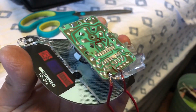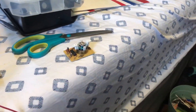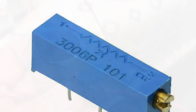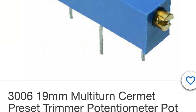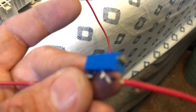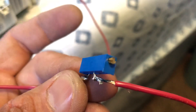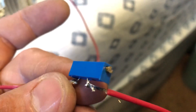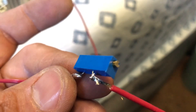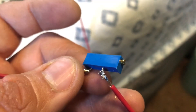I was checking online and apparently you have to get a PCB from a 97 to 01 Camry. This one is actually from a 2000 Camry. I went ahead and swapped that out, and what we're going to do to make it work is add one of these — it's a pot, basically, and you get to adjust the values. That little adjuster lets you make it work with your RPM signal once everything is installed and working.